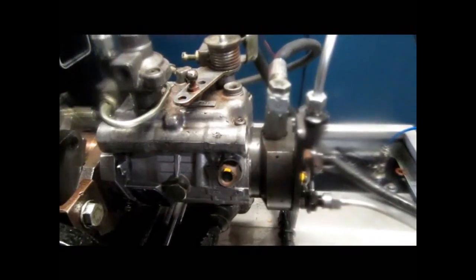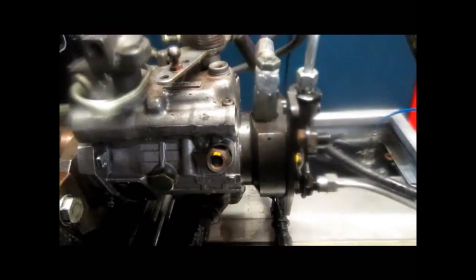Pump timing. I pressurize here with some 80 bars like this. Rotate the driveshaft until it locks. I have zero degrees when it locks like this. I'm going to rotate the pump six degrees, not on the side, to lock the driveshaft. Pump is timed, ready to go today.